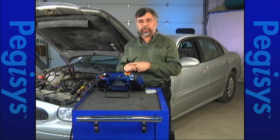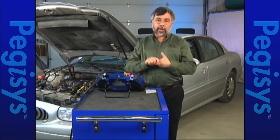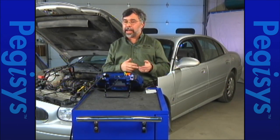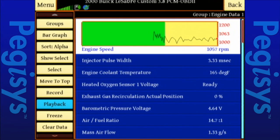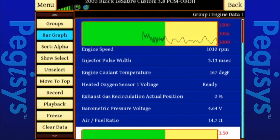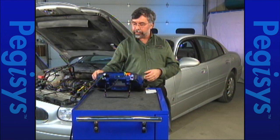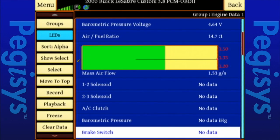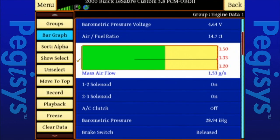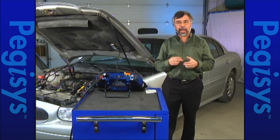I found where the mass airflow sensor is located — right here as it showed me in the picture. I went to the wiring diagram to find out which wire to hook up to to test the mass airflow. Now I'm going to speed scroll down until I find my mass airflow sensor. There it is — I'm going to select it, line graph it, and show that mass airflow sensor by itself. I'll tap show select so I can look at the mass airflow sensor only, increasing to my actual data stream refresh rate.